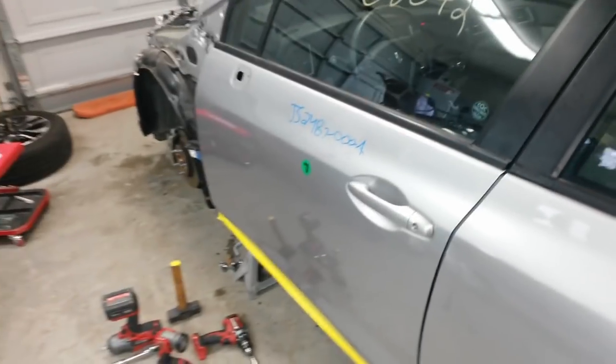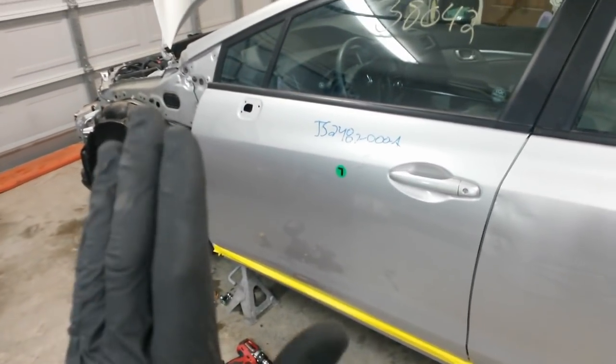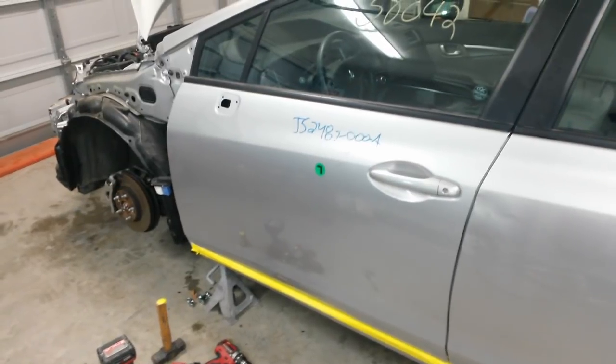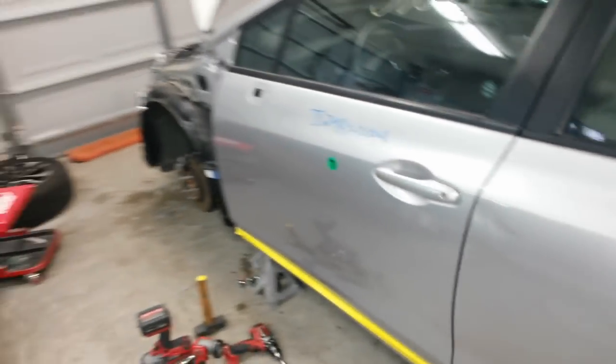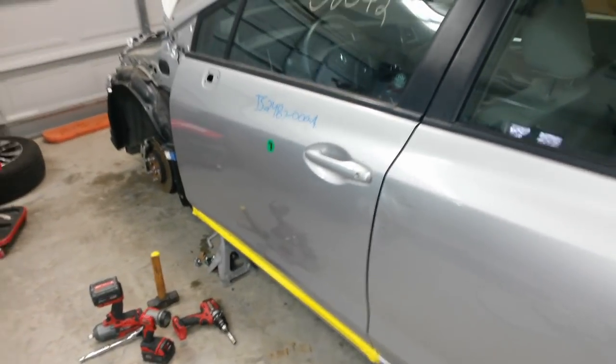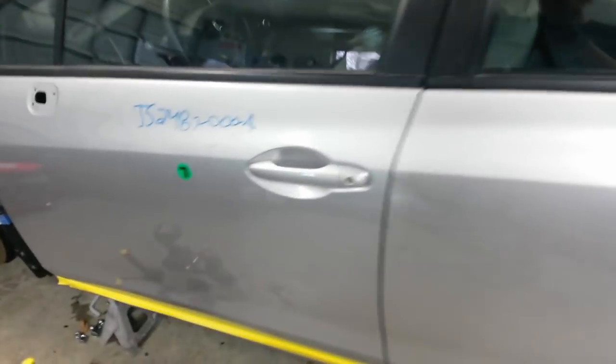I have had one of these, I think it was 2007, where that got bent. I put a strut in it and the wheel was still laid in. The top of the spindle had been bent out. But I think with the type of hit this got, just going along the side, you probably just put it all in the strut. And we could probably still align it with just some smaller bolts from Honda. They make a service bolt set for that.